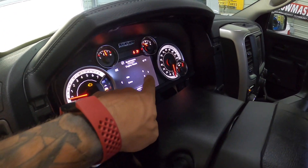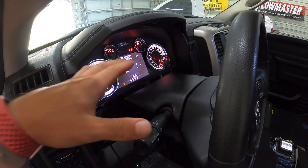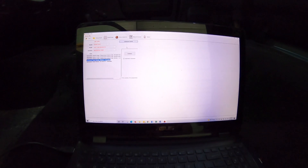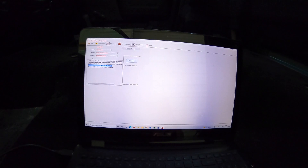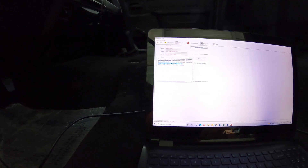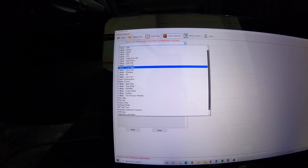Here we are in the vehicle. You can see idle zero hours, drive zero hours — I reset those yesterday out of frustration trying to get it to write our hours, so I cleared it out and reset them to zero. Now you can see we've got the USB cable connected to our PC. I'm going to connect using the PC version here, connecting to the instrument cluster 2013 plus — let's see what happens. We're now connected through the USB cable.